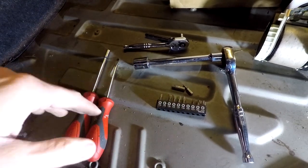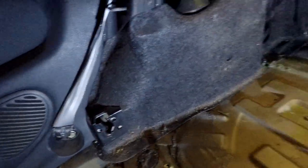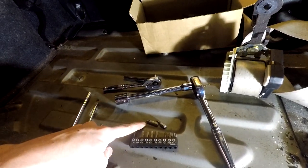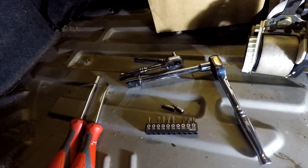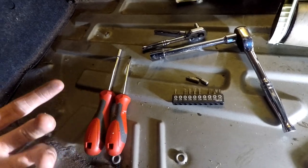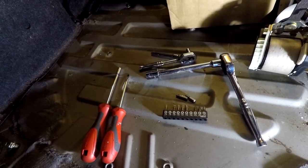To take all the plastics off, this is the general kit that I use. I just use a T40 or T15 for all these little screws, and the bigger ones are obviously for the front seatbelts. A socket for this one down here as well - I'm pretty sure it is a 17mm socket just to take that one off for the back passenger. For the front driver's seatbelt, that's when you need the T40, ideally with some form of socket extension to help you out. A flathead is also quite good just for pulling off the plugs that cover them, or to lift the plastic before you get your fingers behind it. So T40, T15, 17mm socket and a few other bits is mainly what you're going to need for this job.